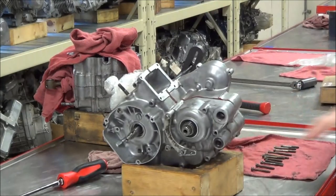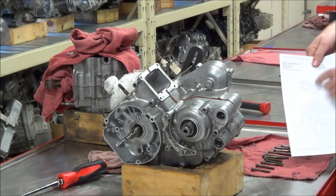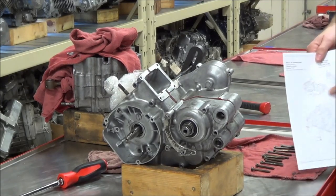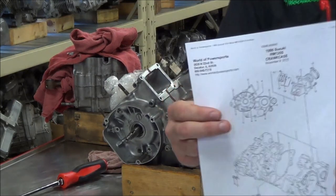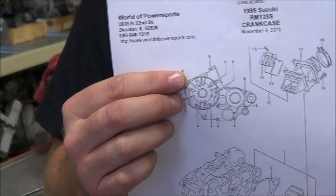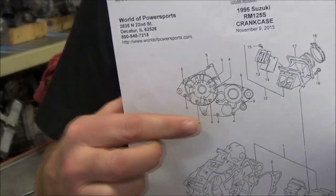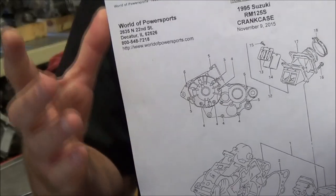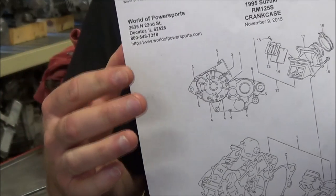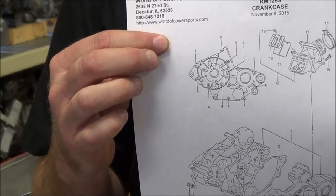Back here on the bench, you can see the bolts here for the crankcase and how many bolts are represented as far as what had to be taken out. What you'll notice here is there are part numbers four, five, and six — that means there are three different lengths of bolts, and when you count those out, there's a quantity of eleven.